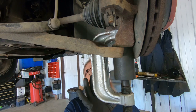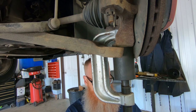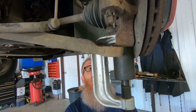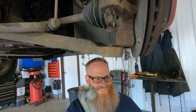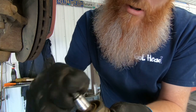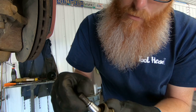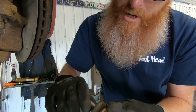We've got our ball joint press in place, and now we're just going to use the air to see if we can't get it pressed out of there. And there's the old ball joint. We replaced this not too long ago in this car, but it's a non-serviceable ball joint, which means there's no grease fitting — that's just the way they make it. If you want to pay a few extra dollars and get a Moog or a NAPA Proformer, you'll get one with a grease fitting so you can service it. But we're just going to replace it with another one of these because it is a warranty item.